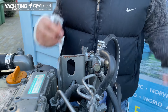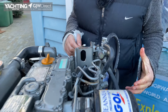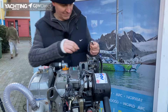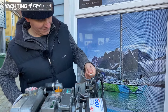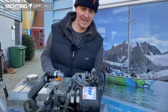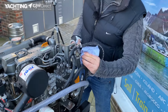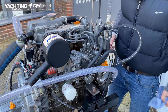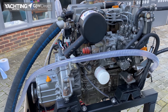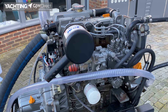We've been pumping for a while now and there are no more bubbles — just clean fuel. We can be comfortable that there's no more air in the system. Tighten the bleed point back up nice and tight, remove the rag, and clean up any last drips. And we'll see if that's helped to start the engine. The engine started really nicely this time — it was a fuel problem and we've solved it.